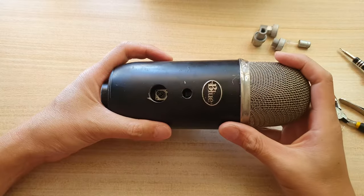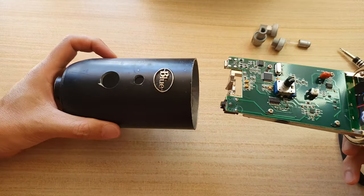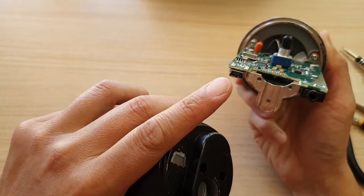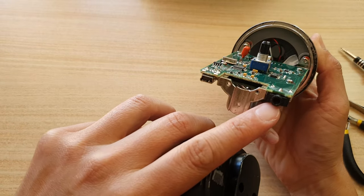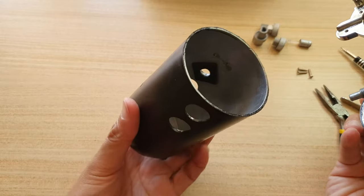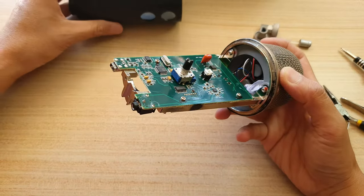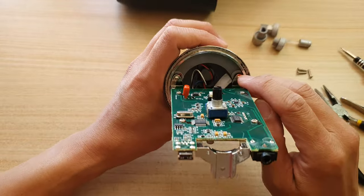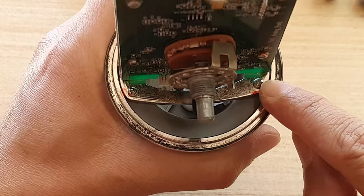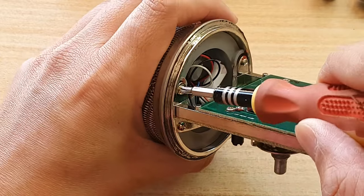Now it's time to take out the assembly — we're going to take out this electronic box from the housing. You can see here at the bottom it will move all the USB ports and the headphone jack out together. This is the housing on the inside and this is the board right here. Underneath here there are four screws — two at the top and two underneath here — and we're going to remove them as well.